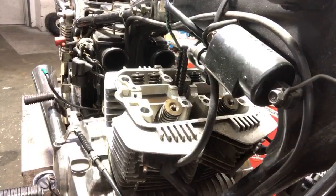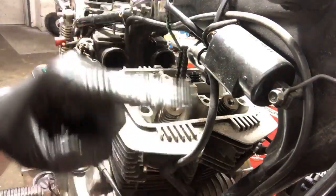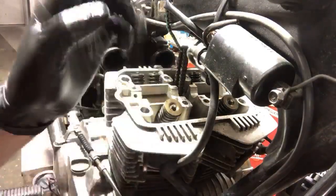Pete, what up, man? Cody the man. What's the difference between intake and outtake valves? Intake is intaking air and fuel from your carburetors. Outtake or exhaust valves are what is going out from that mixture that came in being burnt. So the exhaust valves are what's sending it out through the headers and through your exhaust. So what you're hearing is that explosion going on in your motor out of your exhaust, and the exhaust valves help extinguish that mixture being burnt out of the combustion chamber into the exhaust. So it comes in, it gets exploded, and then it comes out. So you got intake and exhaust.